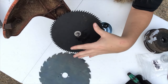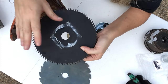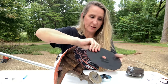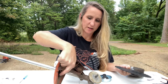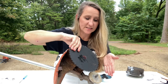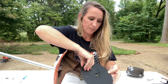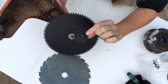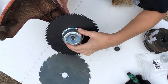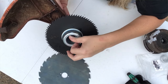When you're putting a blade on, you need to realize which way it needs to turn. On a lot of blades they'll have writing on them - most of the time the writing faces toward you as you're running the trimmer, not toward the ground. Another way to know is that the trimmer head spins a certain direction, and you can tell because your line cutter is on the back of the shield. The cutting teeth need to face the direction it's turning.